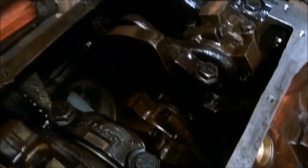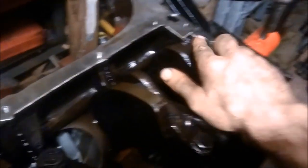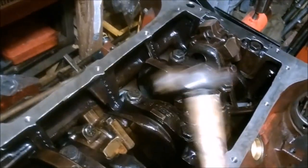After the first time I torqued down the main bearings, I rotated a few times and did it a second time — a few of them turned a little bit before they torqued again. Then I tapped on them with my mini ball-peen hammer with really quick little tiny taps, and this was the only one that actually torqued a little more when tapped. As crazy as that last step seems, I torqued, spun them around, re-torqued, and then did the same thing with the connecting rod bolts — a couple went a little more before they clicked, and one went a surprising amount.